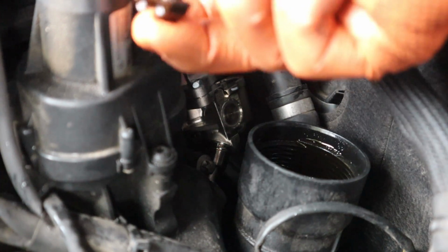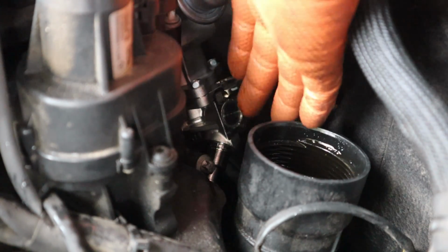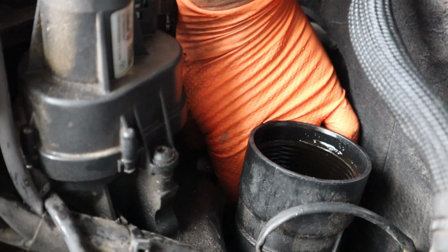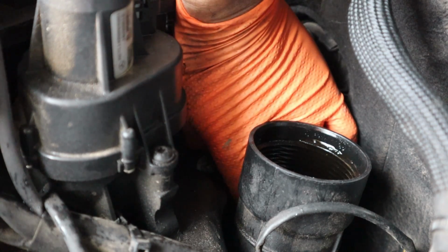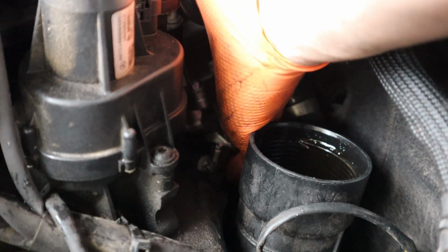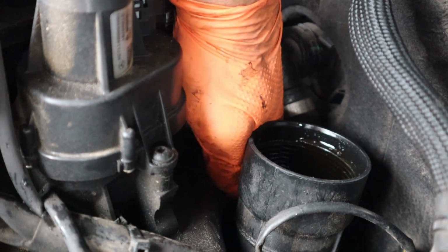And also don't forget to remove your old one of these. This one comes on the new pump. It'll be in there, and before you tighten up your pump, you're going to have to reach down and grab that metal fuel line fitting, the 19 millimeter, so you can manipulate it and make it thread on.